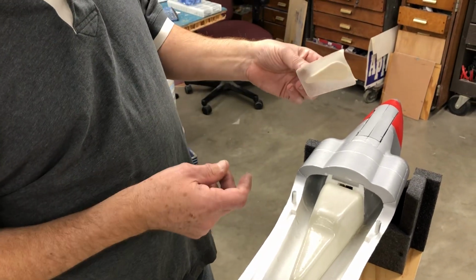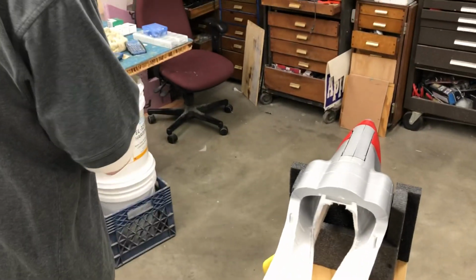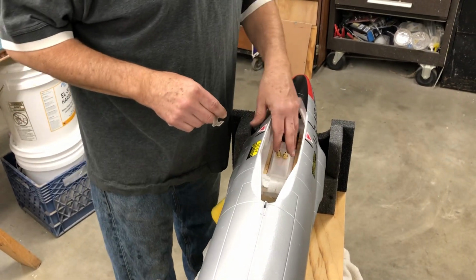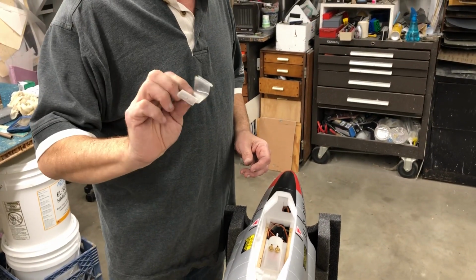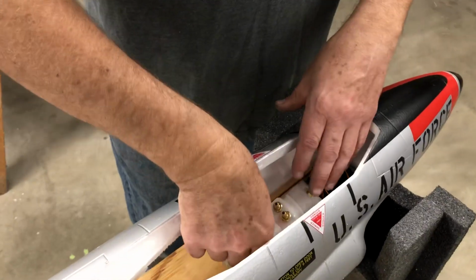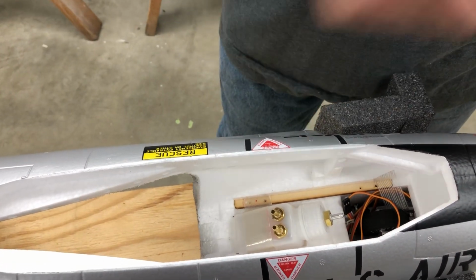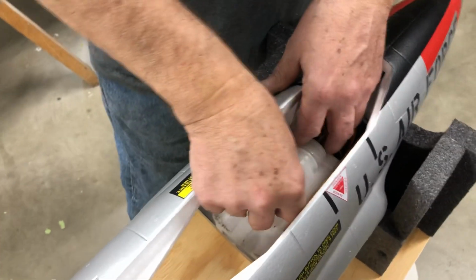We're gonna do it all in one step, and besides that, we're going to make a little receptacle to hold the UAT in place while we're doing a layup. Remember, we cut a hole in there for the UAT. We're going to make this right here at the same time. Just 2 layers of fiberglass, doesn't weigh nothing. And that's going to go right there, and it's just going to get fastened with 2 screws on the red dots to the existing battery mounting rails. So let's go ahead and get this going here.